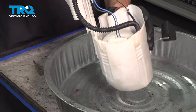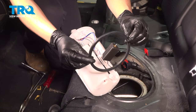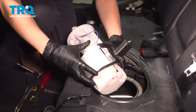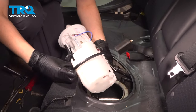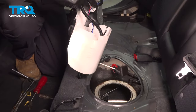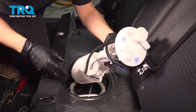Make sure any other wires and hoses are properly attached. Now put your gasket on — this is a brand new gasket. It doesn't matter which direction you put it in; it's flat on both sides. Slide it over the bottom — it won't fit over the top unless you stretch it, which I don't recommend doing. Be careful of all of these lines and the wires that are in the way here.